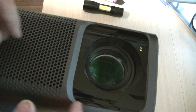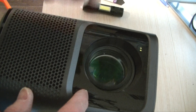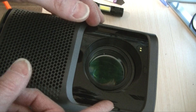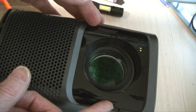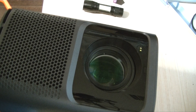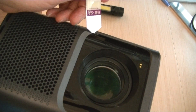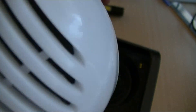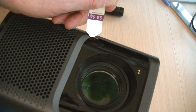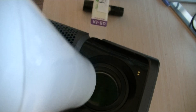I was thinking that maybe the reason why the guts wouldn't separate from the case is because there are screws holding it in, possibly hidden behind this lens bezel. It doesn't look like they used plastic clips though — this piece doesn't want to come off. I'm guessing they may have used glue or double-sided sticky tape to hold it on. To defeat adhesives, you can try alcohol or a controlled source of heat. I decided to use a hairdryer to heat while prying. Unfortunately, I found myself at another dead end.